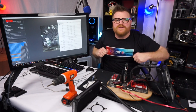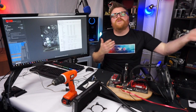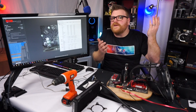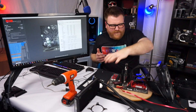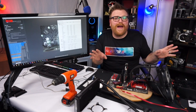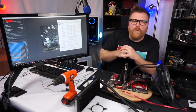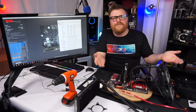Let's do a little switch-out montage and get the newer one hooked up to see exactly what the difference is between old and new - whether it's alright to use an older AIO. When I first plugged this thing in, it made a lot of noise, like water rushing through the pump. It went away in the first five minutes and hasn't come back. So if you plug an older AIO in and it starts making some weird fish tank noises, don't be too worried.